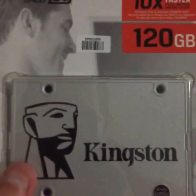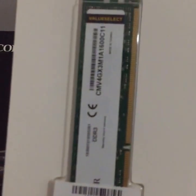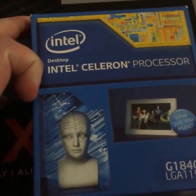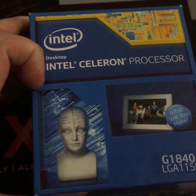We're using a 120 gig SSD drive, 4 gig RAM, and a Celeron CPU. This basically keeps the wattage down, so the whole setup without a video card will use about 45 to 50 watts for the whole system.